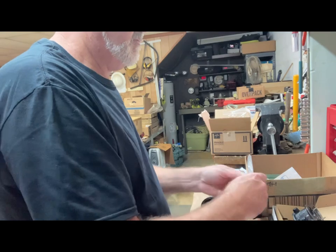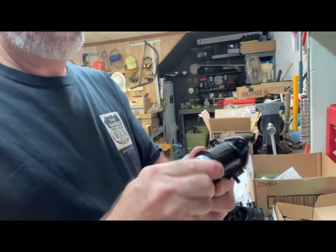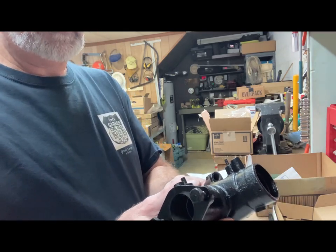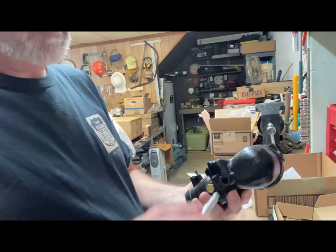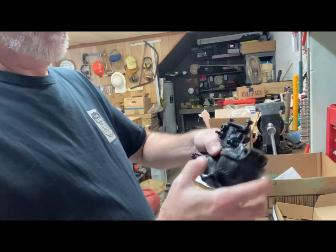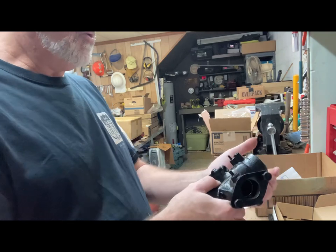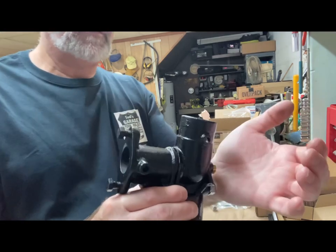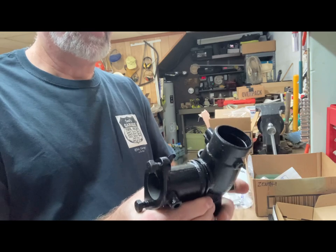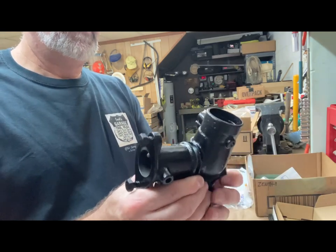And then I think I'll put it in separate. Fits a little snugger in the top here. And just like that, fits together like that. And one of the things you should do when you're trying to get it apart, instead of trying to pry it apart when you're opening your carburetor up, is you just bump that bolt, and you can see when you're bumping the bolt, it's separating the two. I actually got the lock washer on there, but you bump that bolt and it'll allow it to slide apart.